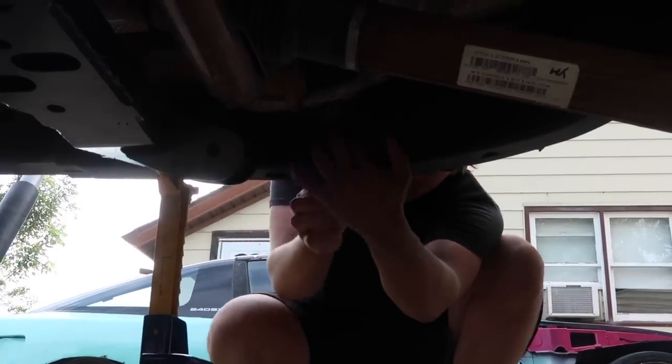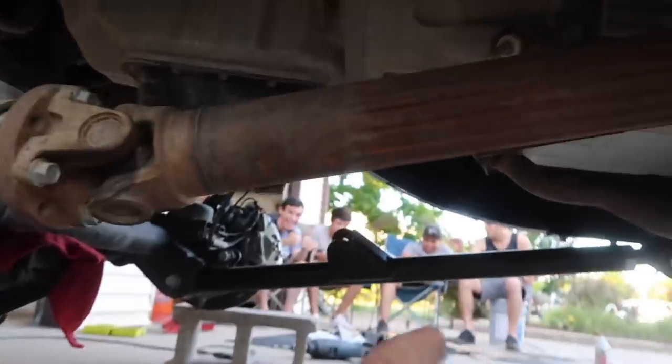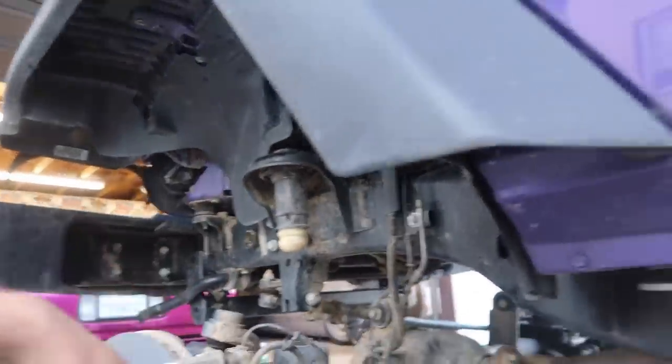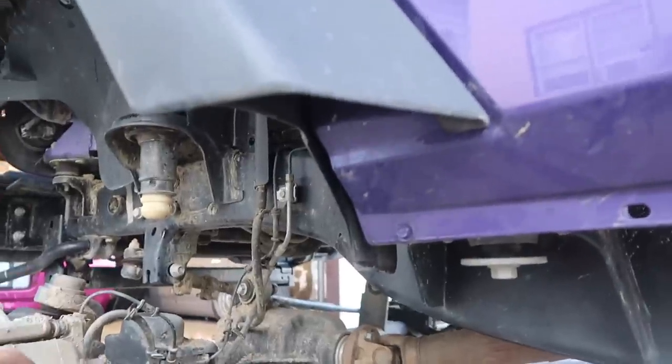Third try — I've been working on this thing for a little bit. Finally got one of the control arms in. You can see I've got this whole brace mounted and torqued down. One control arm is in, I've got to do the other one, then we'll do the top ones and then the springs. We're really starting to actually put some stuff back in this car now.